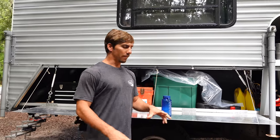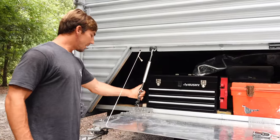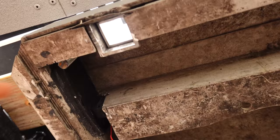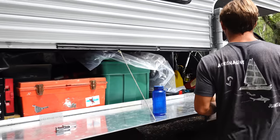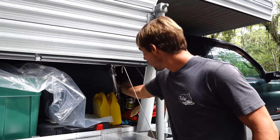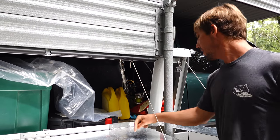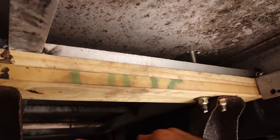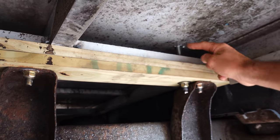For our tie-downs, instead of the conventional route with things that bolt onto the frame and stick way out, we wanted it to be as sleek as possible. The rear tie-down is bolted straight to the aluminum bed with a thick backing. For the front tie-down, when we bought this used camper there were multiple attachment points on the camper side, and the tie-down goes straight through the bed — but it's actually tied into the support system connected to the bed frame in two spots.